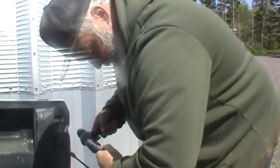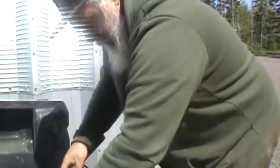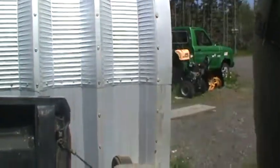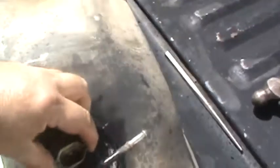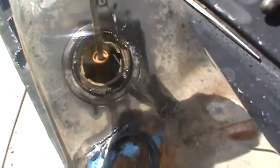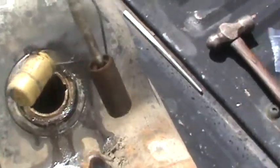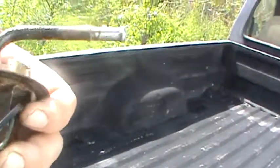She's moving. There we are. See what kind of nastiness we get into — there's the lock ring. Here's my float and all that other jazz. I have a non-brass float to go back in there, a plastic one out of a Jeep. And there's my strainer pick-up deal.